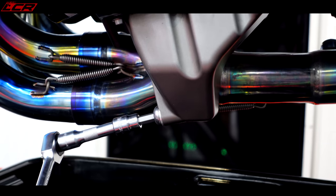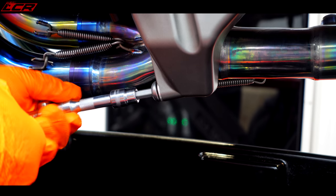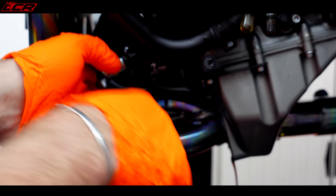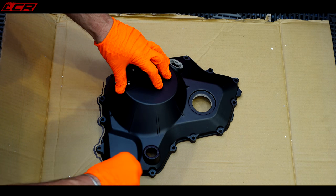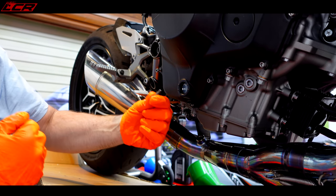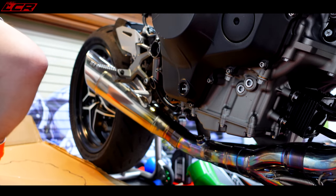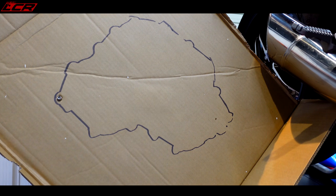I'm going to move the camera — you won't be able to see as well but you won't be able to call me a cack-handed idiot. I'm dropping the oil. Look at those headers — absolutely beautiful. Whilst we drain, I'm going to take this casing off. Top tip: because all of these crankcase bolts will be different sizes, draw a little template of your casing and push each bolt into where it goes in the template. As you take the bolts out, push them into the cardboard where they go, and they're sitting there until you need to put them back in again. Top tip for the forgetful.